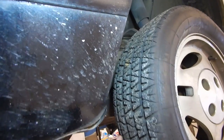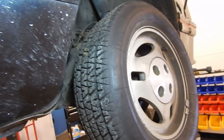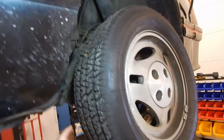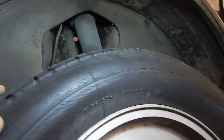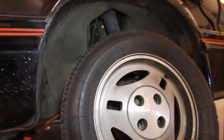With our other camera, let's take a look at the tread. You can see the tread looks pretty good, right? So what's wrong with these tires? Well, what you're going to find on a lot of these TRX tires is that their age is what's doing them in. Even if the tread is good on them, look at how much dry rot there is on this tire — look at all the cracking, and the cracking is even in the tread. So these are trash. These are absolutely unsafe. They can't be used on the road. They need to be replaced.